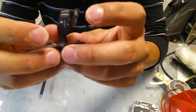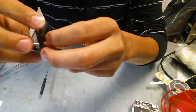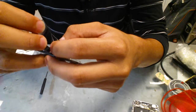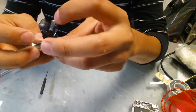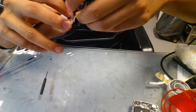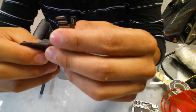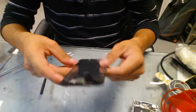Now the connectors, you have to make sure that they are in order, and this one here, the one with the speaker, goes behind the one here, so you need to fold it up carefully, and the one in the back has to be in between those. So fold this one behind it, and then this one under it, and you're good to go. Once all the connectors are in place, it has to look like this, like they're not behind or in between any of them. They all have their own connector space, and we're almost good to go.